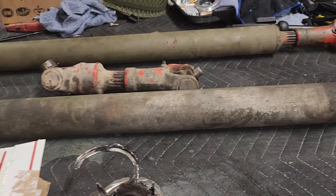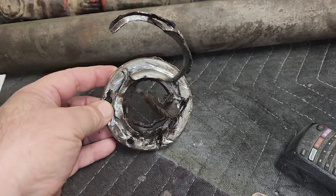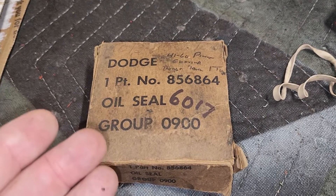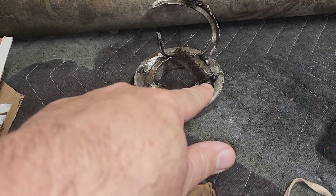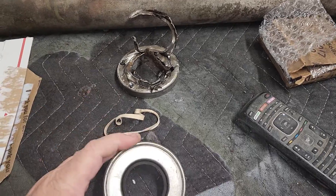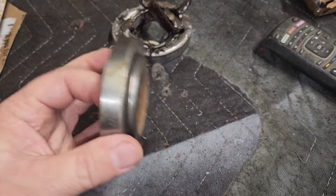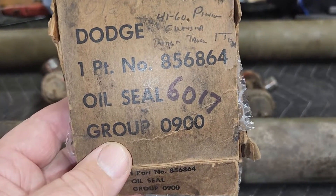I had them soaking for a while, so I'll start pulling them apart probably Friday night and cleaning them up. But the big thing is this pinion seal — I showed you this, just a disaster. This differential pinion seal is leaking really bad. I had a hell of a time getting it out. Through a little cross-referencing, this is what I found: according to the guy online it's three and a half inches across and 1.75 inches in the center. Let's see if it fits — shazam, it's looking good! Turn it over — it's got the notch in the back. Yeah, this is it. Old new stock, so I'll hang on to this part number.